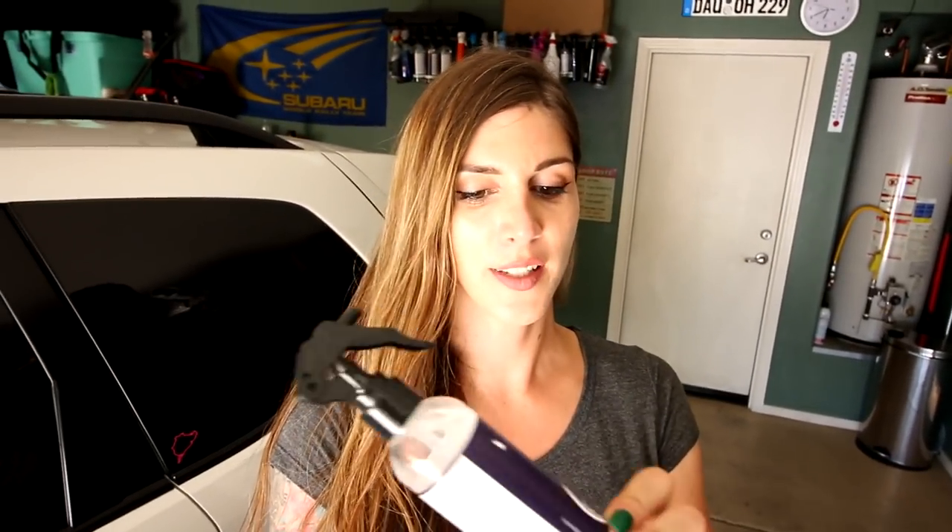Time for the final step — I want to protect the seat now that I have it nice and clean. What I'm going to use is textile and leather sealant from Nanolex. This stuff is kind of like a ceramic coating for fabric. I'm going to apply it onto the clean seat, and after 24 hours it's going to cure and basically make my seat water repellent — like a duck. It's going to turn my seat into a duck. The label says wear protective clothing, eye protection, face protection; if on skin, take off immediately and rinse with water. This stuff is no joke — it's really nasty, so I'm going to make sure I am well protected before I put it on my car.